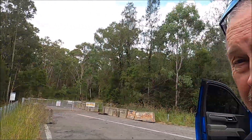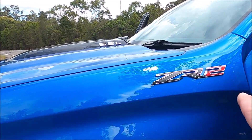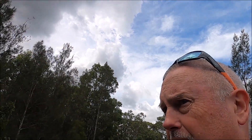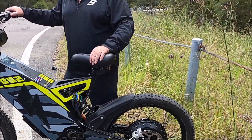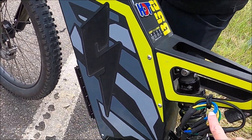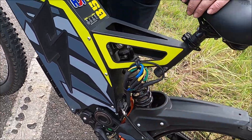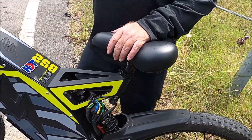We've performed a rescue - we've come out in Jason's truck. Have a look at this thing - we're talking Chevy Silverado ZR2, 6.2 liter. You should have heard this thing coming out here, it was awesome. Back to the bike - we actually had to wire blue to yellow, yellow to blue, and green to gray. Unfortunately that still hasn't worked, nothing. And if you hear the motor... looks like back to the workshop and back to John for probably a tear down of the motor.